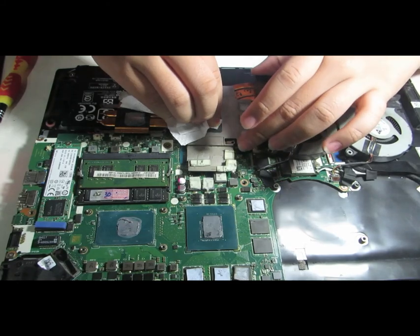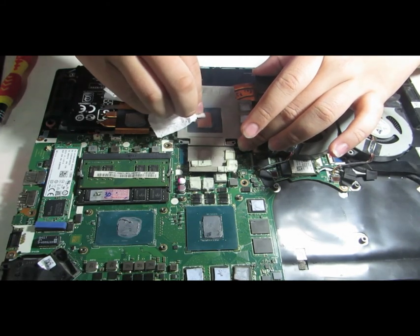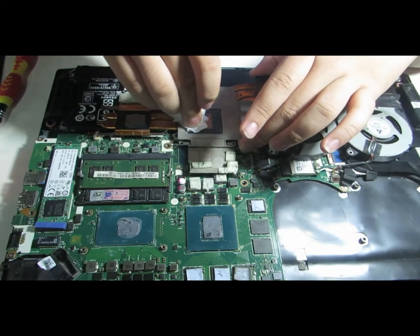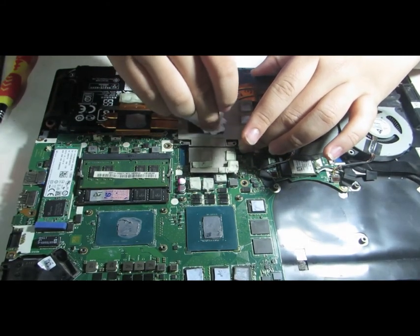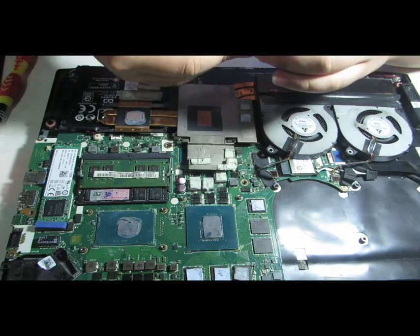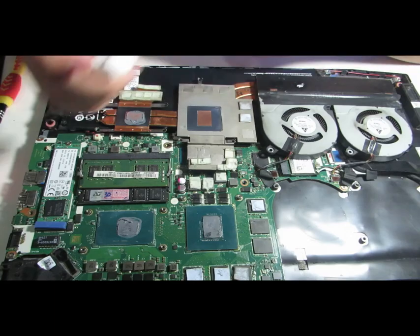Avoid contact with the thermal compound itself because it's very hard to clean out, and try not to mess it around these parts, or you're gonna have a hard time. It's not electrically conductive. It was built to not be electrically conductive. If it was built to electrically conduct, let's say that your computer won't stand a chance if it got out of this one.